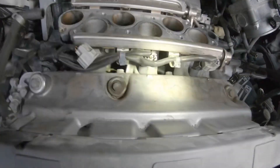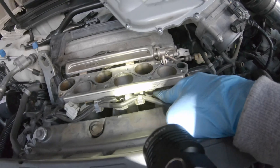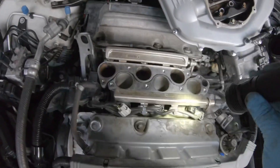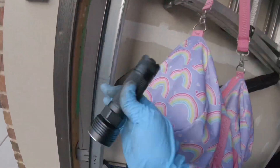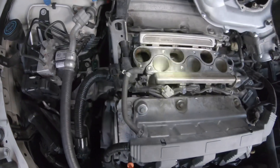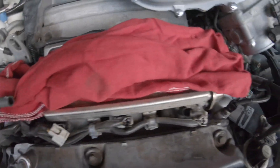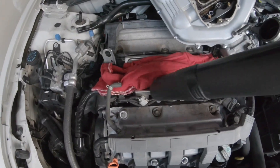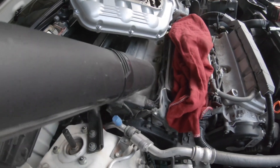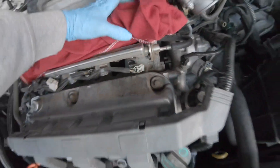The next step is we've got to remove the injectors and the fuel rails as a whole assembly. It looks like a 10-millimeter bolt right here and right here, same on the other side. But before we do that, I'm going to cover this up - if you have any compressed air or a blower, you want to get all that dirt off that's hiding under there. Because if you take off the runners and the injectors, dirt is going to fall into your cylinder heads and you don't ever want that. I'm going to blow air right here. That valley right there is like a freaking dustpan - there's still dirt under there.